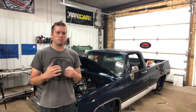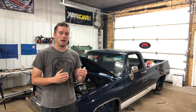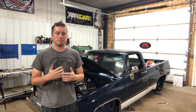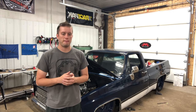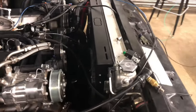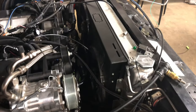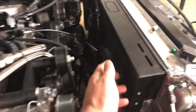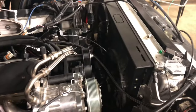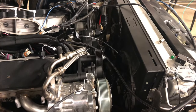Shrouding does create a bit of a space issue, which is why I try to make videos like this — so you see this ahead of time and build your setup around it. What fun is a race car that can't be cooled off? As you can see, Hank the C10 has a Derale brand dual fan setup with a nice shroud. These are designed and engineered to work properly. I don't have overheating problems on the projects I've built because I follow these principles. This setup is a pull configuration — pulling air through the radiator, working with air coming in through the grille.